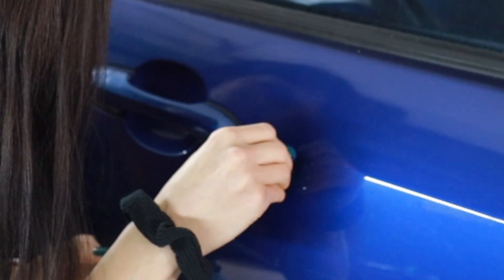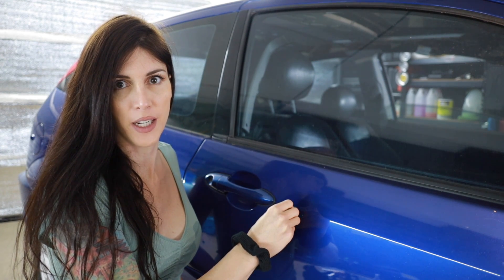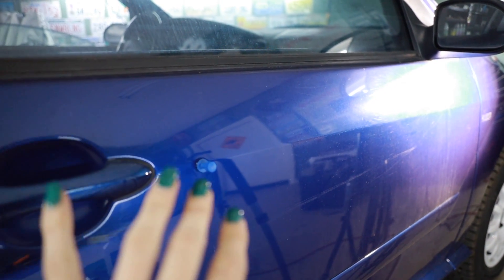Hot glue gun kind of sucks. Got some hot glue on there — mush it down and hold it in place, nice and firm. Then let it dry for a couple of minutes. There are various methods for paintless dent repair. This is the glue pull method. There's also the rod method where you drill a hole or find an access point and get behind panels, then massage the dent from the rear. On areas where you don't have that option, that's where these glue tabs come in. Keep in mind this is not meant to be a tutorial — I am not a professional. But I did watch a professional remove dents on my Audi TT in this garage for about four hours, and he gave me a lot of pointers. So I'm regurgitating what I've learned, and in this video I'm going to half-ass attempt to do it myself.